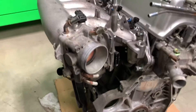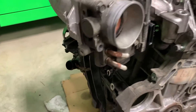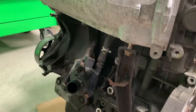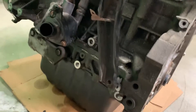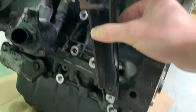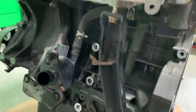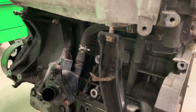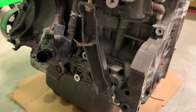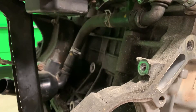Starting off — this intake manifold: the head sits about 17 millimeters higher on this block. Basically it lifts the intake manifold up in relation to the bottom of the block. So if you set that intake manifold stiffener bracket all the way up against the intake as if it's torqued, we're not even close to that bolt, and it makes it tough to use. You'd have to get a spaced or longer bolt — not worth it. This intake will be just fine without it; that was just a durability thing.